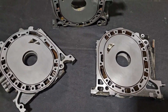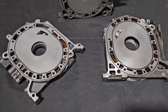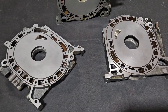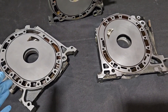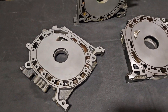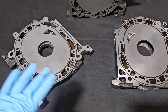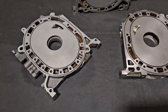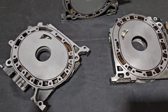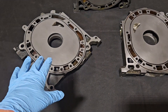So I'm always pro-lapping. I don't recommend lapping things that don't need to be lapped — there are a lot of times where you don't need to lap, and a lot of motors don't need lapping. But in a lot of cases motors do need lapping: high wear, potential warpage, water seal failure, and corrosion to water seals. This was a perfect candidate to resurface and lap, and with proper cleaning and polishing out the running surface, this motor can run just like an OEM motor all over again — probably rebuilt multiple times with a continued life cycle as if these housings were almost new again.